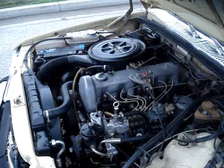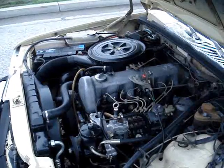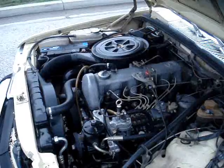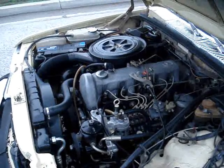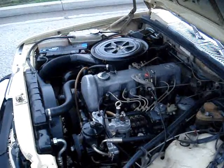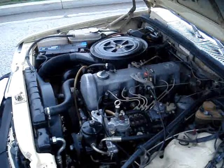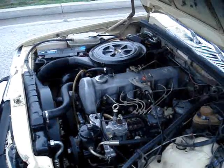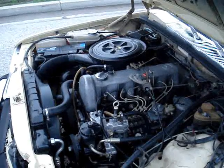The stock turbocharger has been adjusted to achieve 14.7 PSI of boost, measured in second speed range at wide open throttle. This engine has been completely and thoroughly rebuilt, and although the intake and exhaust manifolds have been port matched to the cylinder heads, the engine uses the standard 05 camshaft, and there have been no modifications to the injector pump other than the ALDA screw being backed all the way out counterclockwise.